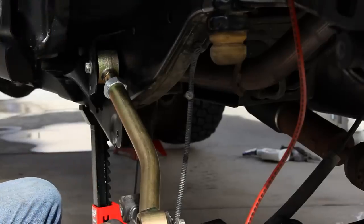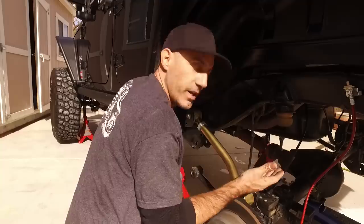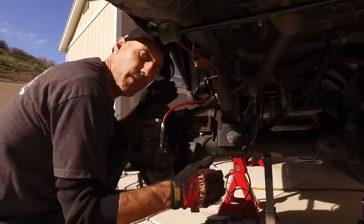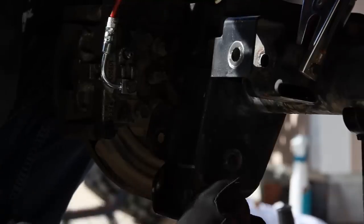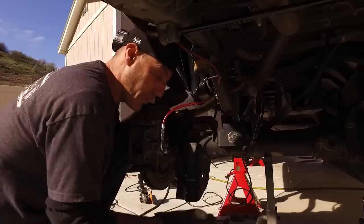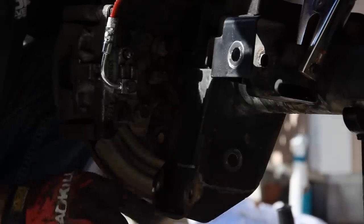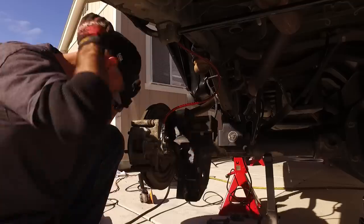The reason I'm doing the tops first is because we're going to do a little bit of surgery on the bottom of the shock bracket. The six pack shocks are going to mount a little bit higher on there. What you want to do is measure down from the axle and also from the top of the flange, draw a line, and cut the old shock mount off. When you trim this up you end up getting another three inches or so of ground clearance right at the end of the axle, inboard of the wheel and tire — a really helpful and trick little thing. So I'm going to cut this old shock mount off, trim and grind the bottom of the shock mount and control arm, and get that done.